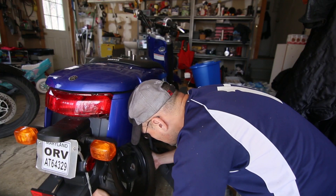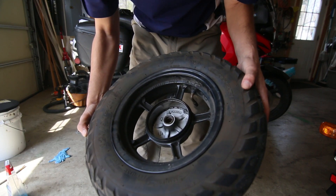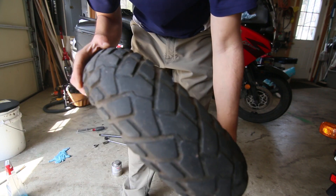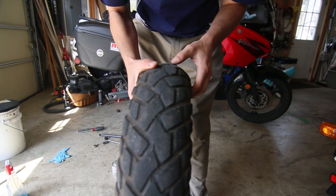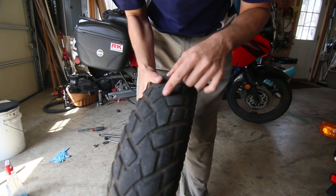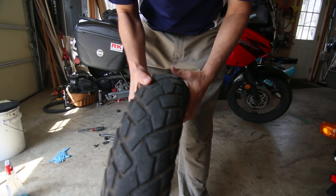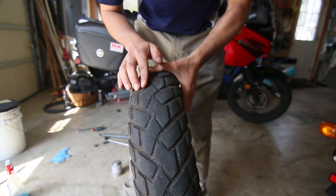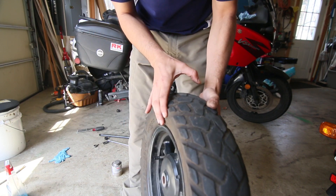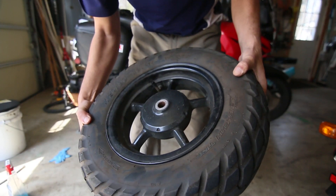There we go — and here's the tire. As you can see, it's a really light tire, it's a 120/90-10. There's still some tread but these are the wear markers, so when the tire is this worn it's good to change it. This is pretty much done. There are these humps — that is the cupping of the tire after it's been worn.